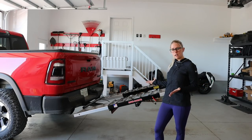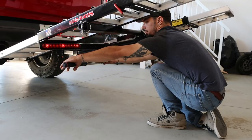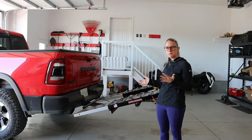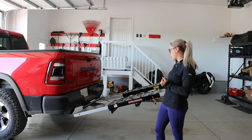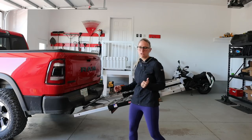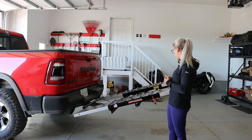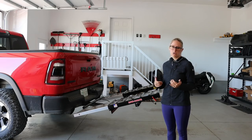All in all, that's what your setup is going to look like. It took us about 20 minutes to install and then another 15 to 20 minutes to make sure it was torqued to spec and all the measurements were correct. The installation essentially breaks down to putting all the pieces together, then making adjustments. For all the half-inch bolts, that's going to be 70 foot-pounds. Also, when you're opening your tailgate you want to make sure the racks don't get any closer than four to six inches. You're also going to want to test your brake lights and hazard lights once it's all plugged in.